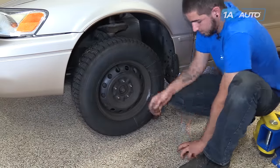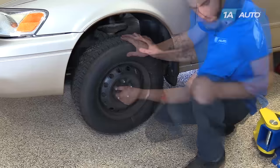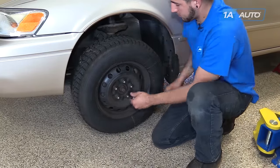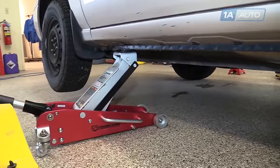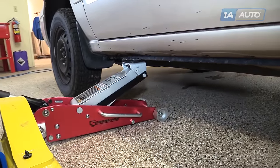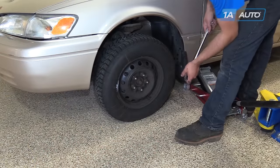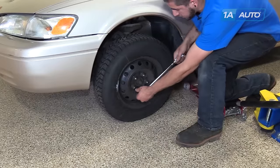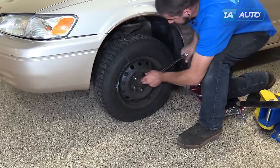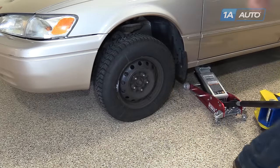Reinstall the wheel and tire. Tighten down the nuts. Put the vehicle onto the ground and check that they're all seated. If you've removed the tire, only lower the vehicle until the wheel touches the ground. With partial weight of the vehicle on the ground, torque your lug nuts to 76 foot-pounds in a cross pattern. Then you can remove your jack the rest of the way.